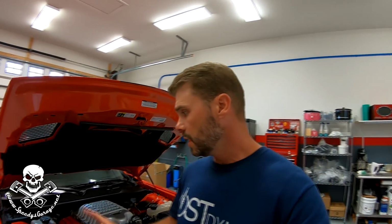And then I switched the rear O2 sensors. I didn't show you that because it's just me unthreading them and then threading them back in and plugging them up. And they are exactly the same. They were the same length, the same clips, the same everything. Plugged them back in. I have now driven the car for about 2 weeks and the code has never come back.